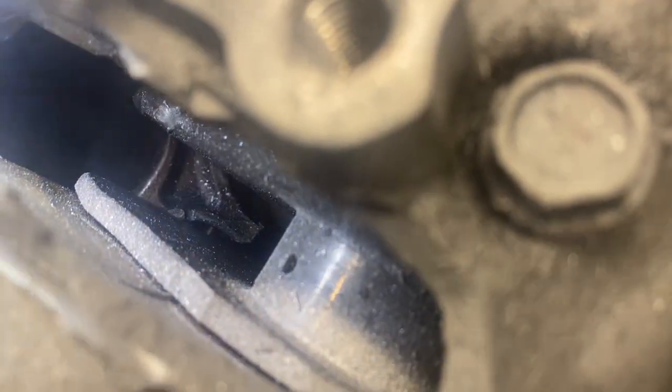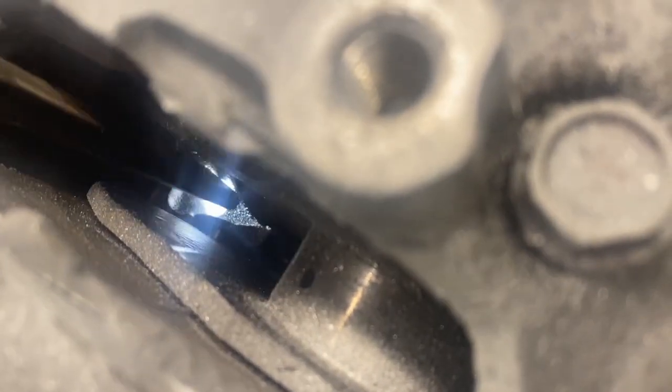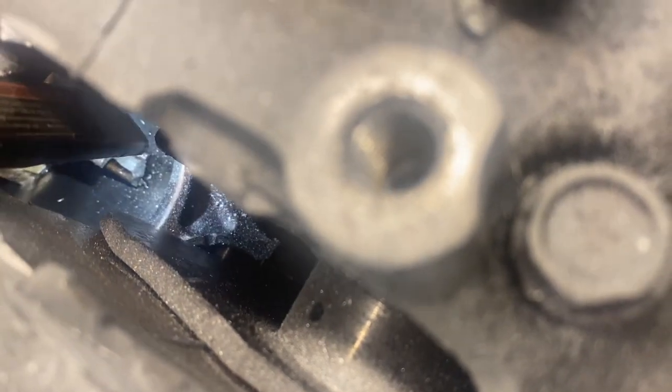And then down in there, that chunk is loose. So I'm gonna try to get that out. That's the end of the number one connecting rod. There's the number one journal, which seems to be all clear. We've gotten the cap out. So I see a little gouging right there where I'm assuming the block or the cap gouged the block, but I don't know why the crank won't turn. I'm gonna work on getting that chunk out. It's loose in there, so that's not holding it up.